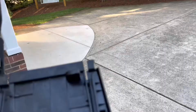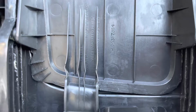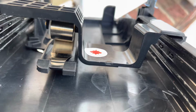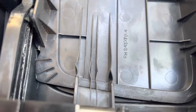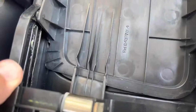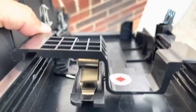So I thought I'd tack on to this video repairing the other piece. If you recall, I said if I could bend it out, I will. And while it's not perfectly straight, I did take a hair dryer. I don't have one, my wife has one. I was able to bend this back down to here. I got it pretty hot, applied pressure, and then while it was down and hot, I let the hair dryer go cold and allowed it to stiffen back up, because a lot of people just apply heat and get it where they want, but you got to apply cold air or allow it to cool while holding it in place. That way it retains where it was. But I think I have a spare part now.